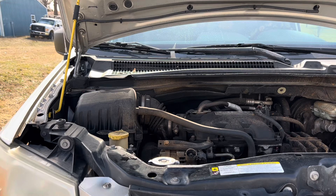We have a blown head gasket. This obviously has a blown head gasket or a cracked head — there's no question about it. And so you're looking at a major repair. At minimum, the heads would have to come off and be checked. You've got to decide if the vehicle's worth that kind of repair at that point. If you're going to do it yourself, you need to be very handy and make sure you know what you're doing before you do it.